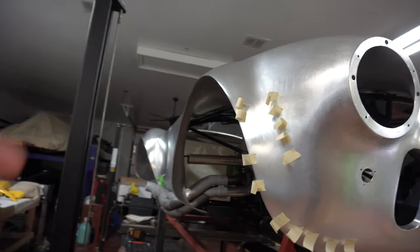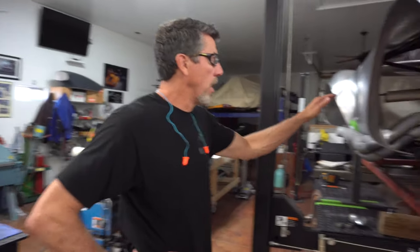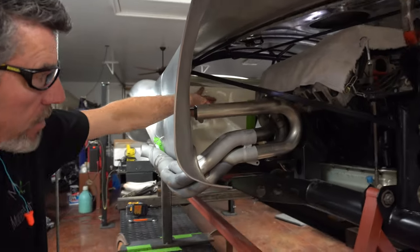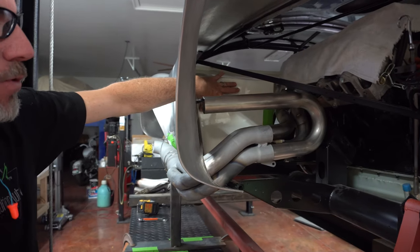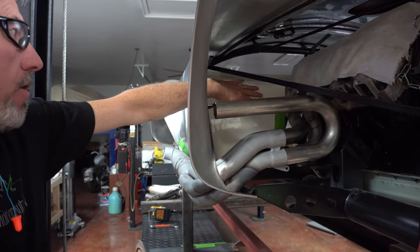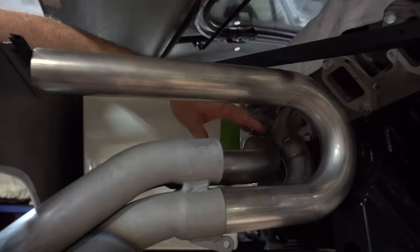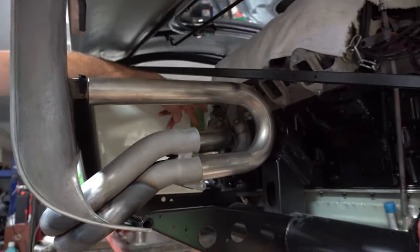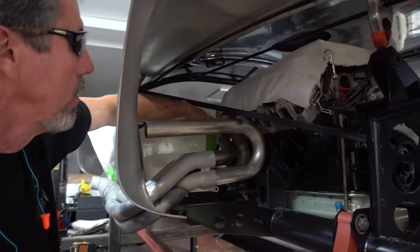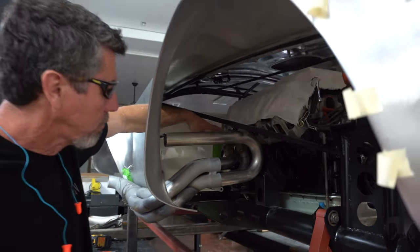These cars have some difficulties building headers around the foot boxes. It gets really tight because the foot box is all fiberglass and gel-coated, so they obviously don't like heat very well - it breaks them down. The foot boxes on this car have all been redone, same as the last car. The plan is once done with this, he'll send the headers off to be coated inside and out to help pull heat away, and they'll probably still put a small piece of wrap in there to protect the foot box.